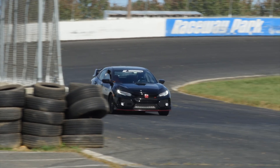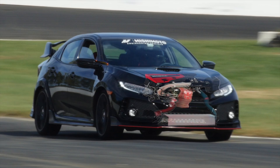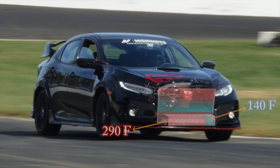Here's an on-track breakdown of what's happening. This is your Civic Type R, this is the air inlet for your intercooler, and here is your K20 C1 engine and OEM intercooler. A couple things start to happen when you put a long duration and steady load on the car. The intercooler starts to heat up as it tries to keep the compressed air from the turbocharger in check, and the incoming airflow transfers that rejected intercooler heat directly into your radiator. We've seen on-track temps as high as 290 degrees on the inlet and 140 on the outlet.